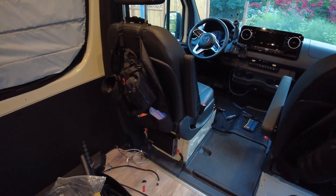And I'm getting all kinds of errors — a steering malfunction error, and all the assist features like lane assist and brake assist aren't working. All kinds of errors are flashing on the display. I was hoping it was a low battery, so I checked the main battery and put it on a charger just in case, but it's good and strong. Then I checked the little auxiliary battery that controls something in these Sprinters under the driver's seat — voltage on it was pretty good too. So it's not those two things.